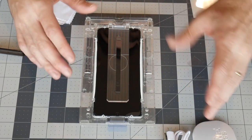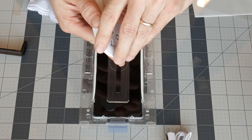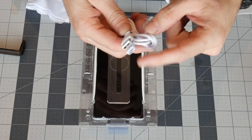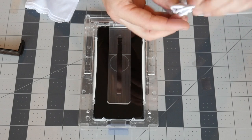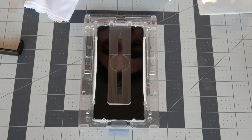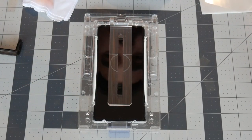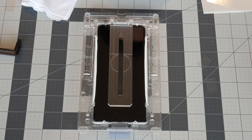While you're waiting for that, go ahead and get your UV light out. It comes with a little micro USB cable. I'm going to use an external battery pack to power it up. Just make sure the glue has covered the whole screen, and once you see it's covered the whole thing, don't touch it — then start curing.